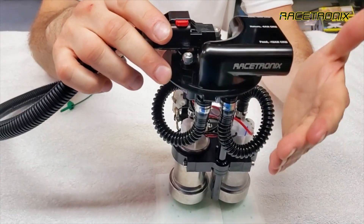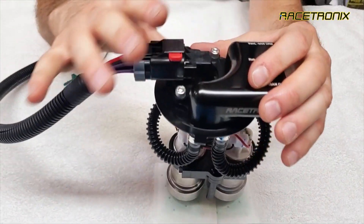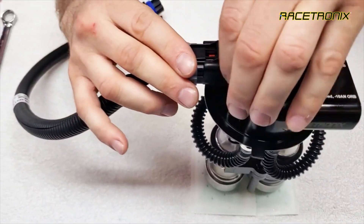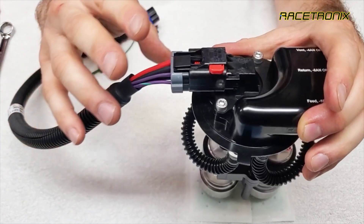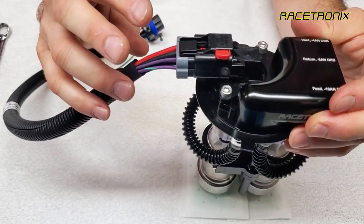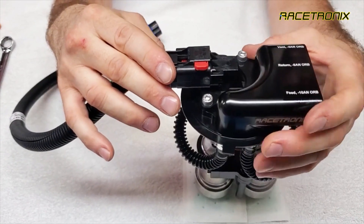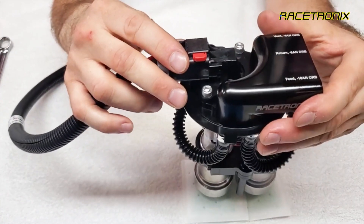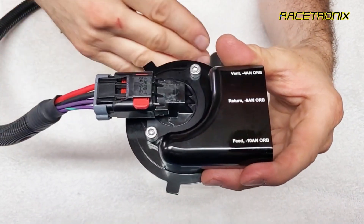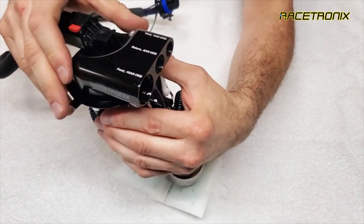The performance is greatly improved because we have a custom six-position bulkhead connector that's vapor-proof. It doesn't allow vapors to escape or fuel from the tank. The conductors feeding the pumps are 10-gauge wires, with a separate ground and positive feed to each pump. To prevent ground differential issues from affecting the level sensor signal, especially on late-model digital dashes, we have an independent ground and level sensor signal wire coming out of the hanger as well.